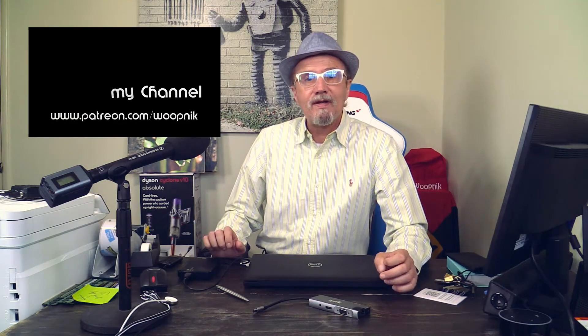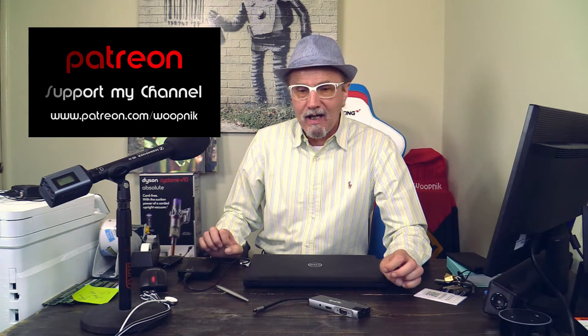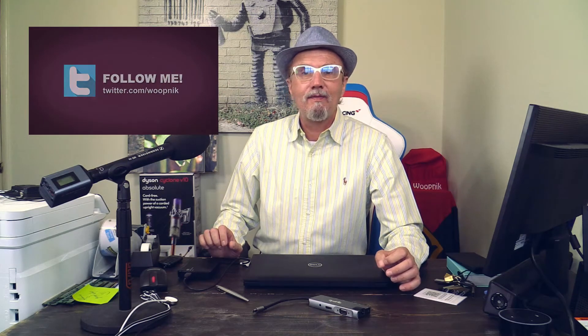There is also an audio port here. When the laptop you are using is absolutely quiet and you have checked that the volume is all the way up, you can test this with the mini dock — converting USB-C into audio — and see whether you can hear something on this audio port or not. These are all the steps you have to take to figure out what is wrong with a laptop. That's it for today — please look out for my next video, like it, and subscribe to my channel. This is Michael with the Whoopnik channel, signing off. Have a great afternoon, bye!